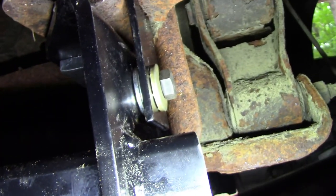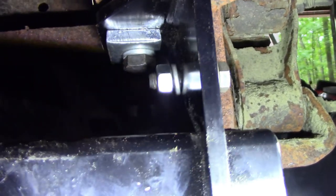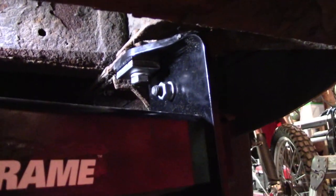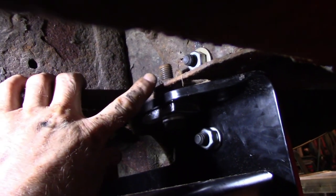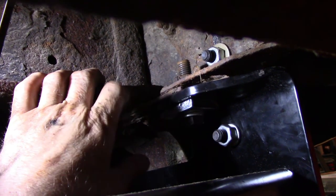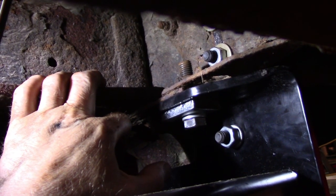It's the conical deal on the outside, two flat washers on the inside, and you've got the lock washer and lock nut. Everything's tight. The welded nut — that bolt goes pretty far up, so if your welded nut breaks, that's what the extra washer and nut is for. I only have two nuts and two washers left over after addressing everything.